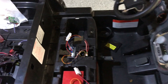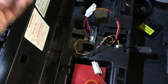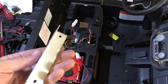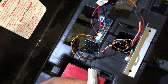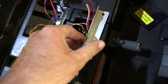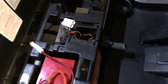We have the speed controller mounted down in between the frame rails right here. I cut out the entire plastic box where your factory controller used to sit because this controller is teeny tiny and the new controller is huge. You do want air to pass by it, especially if you're on 24 volts or up. I created this bracket and it actually mounts to these steel frame rails down here — just like this. It's just a piece of five-inch long aluminum angle iron from Home Depot. I had some laying around and it was the perfect ticket. Speed controller is mounted.